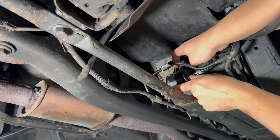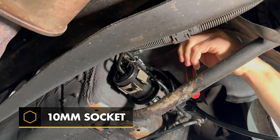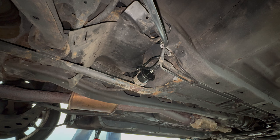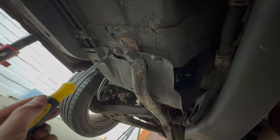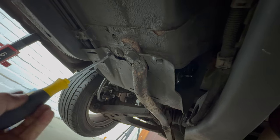And now it's time to reinstall the filter. The proper place is easy to spot, given that it's the only part of the underside that's not dirty. Now, let's start the car to see if all is well. And as indicated by the lack of gasoline rain, yes, the new filter works and is properly installed. So let's get the cover flap reseated and this job is done.